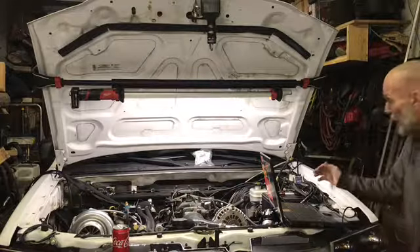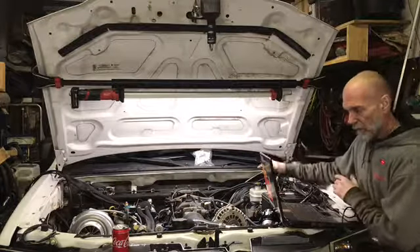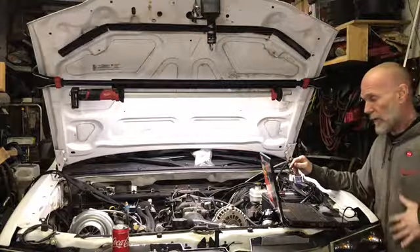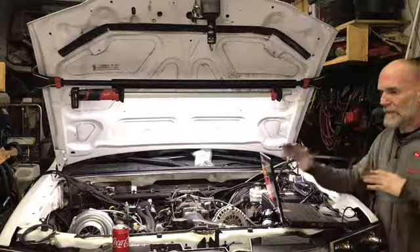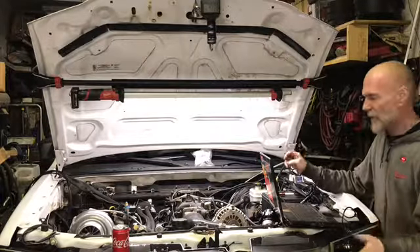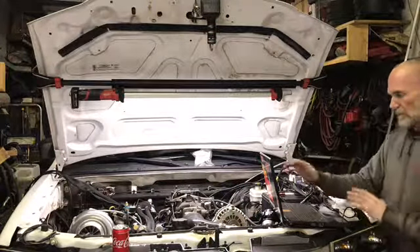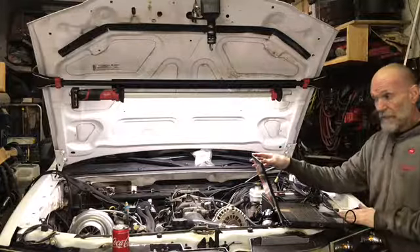Okay. So I got the wiring done, I got the loom in, I got it tied into a low reference — it's not the low reference according to the wiring diagram, but low reference is low reference. All the gauges read off the low reference, it's just a different data stream that they read. So I've got the HP Tuners hooked up here, and I have the gauges laid out. Now I'm going to test it, see if it works.